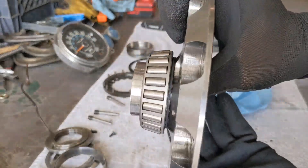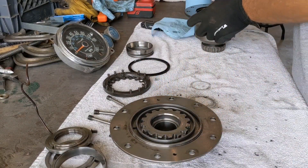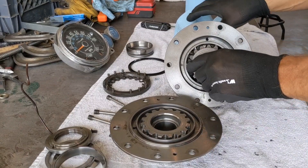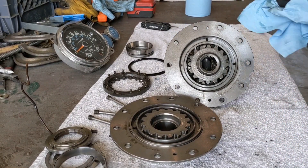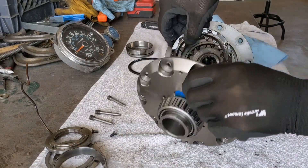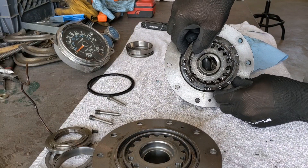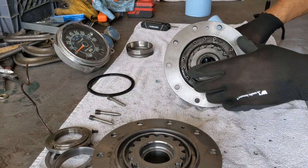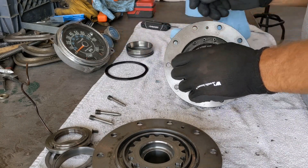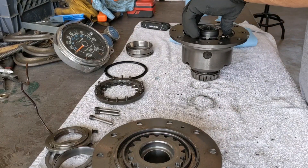Air forces the bonded seal up, and that's what pushes the clutch gear over to lock onto your side gear. I'm going to take my seal housing back off so I don't damage it. Now we have this half of the case — no other loose moving parts other than the bearing. If you bring over this half of the case, the gears line up with your clutch gear. When air enters from behind the bonded seal, it pushes everything out to the side and your clutch gear locks onto your side gear — that's what locks your axle sides together, hence the term locker.